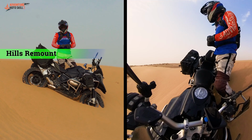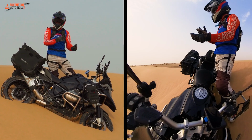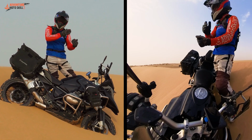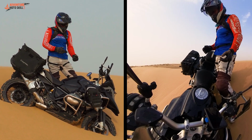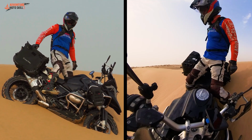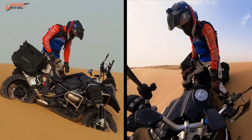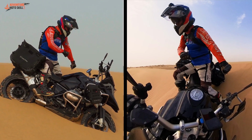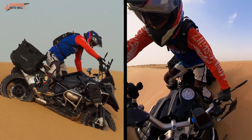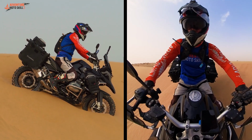Now you may not have sand dunes where you ride, but I'm sure there's plenty of hills and the same scenario can happen where you've come to a stop, the bike is leaning on its side. In a situation like this, I just simply like to step over, get my foot on that foot peg, and again, I want to use my knee to push that bike as I lift the handlebars up. So I come up, secure the bike.